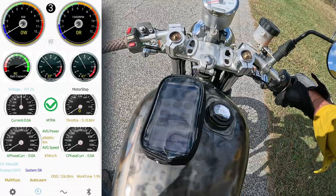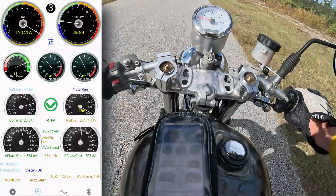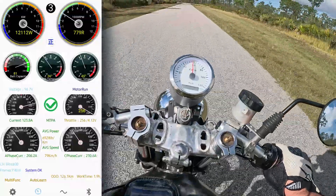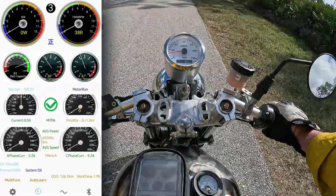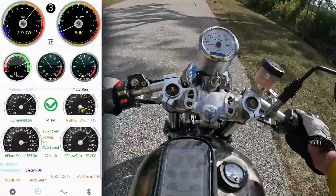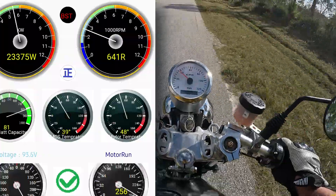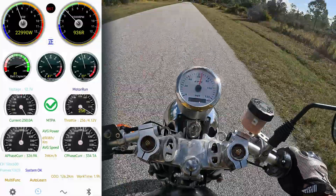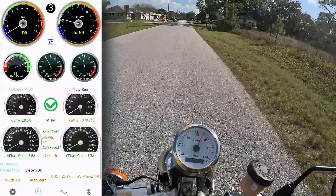I've got it set to 125 line amps max, so full throttle goes right to about 12,000 watts — yep, there's 12,000 watts and that's all she gives. That little '3' is going to turn into 'BST' when I hit boost, going about 60 mph. Now I'm going to go full throttle and hit boost — watch the little three turn into BST. I get 15 seconds. There's full throttle, here's the boost button — there's BST — a little delay — and now it goes to 23,000 watts. I'm going way faster, almost 80 mph, in the same amount of time. That works — pretty cool.